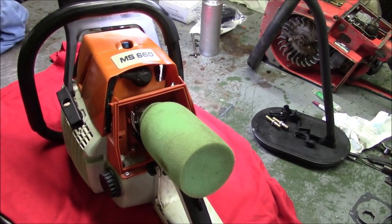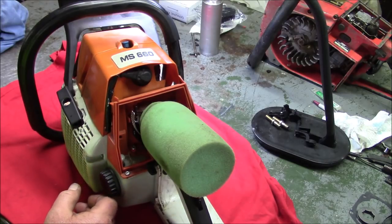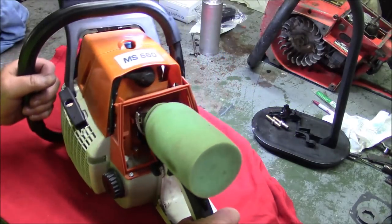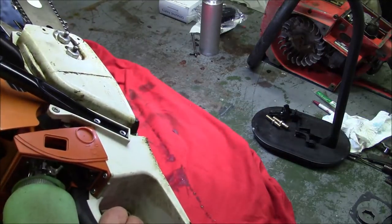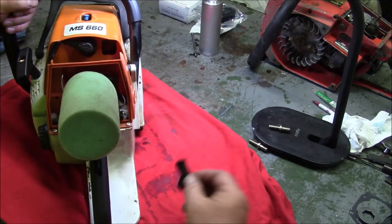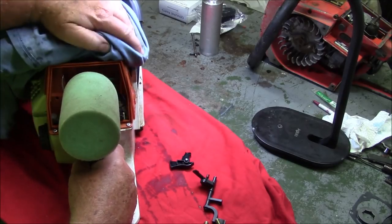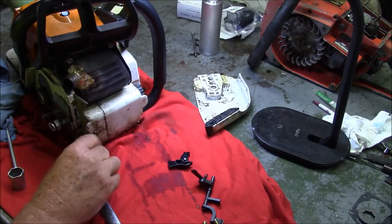Well, I'm going to mix a little bit of just for fun in with the work and bring this saw up to at least a closer spec than it is right now. See, it doesn't have the better handle. I'm not going to really go out logging with this thing. It's more for fun, and so I don't care if I have the better handle on here, although I have a hunch that I may eventually change that. But what it does need is the OEM trigger and choke, and it also needs the OEM bar studs pretty much desperately. So that's what we're going to do on this saw, and then put it back in the retirement home. Get some of these hyper tough washers in there.